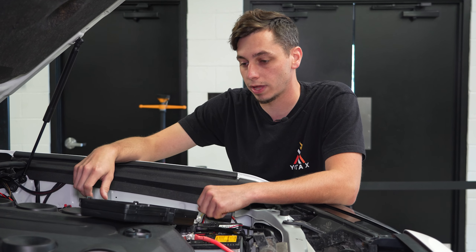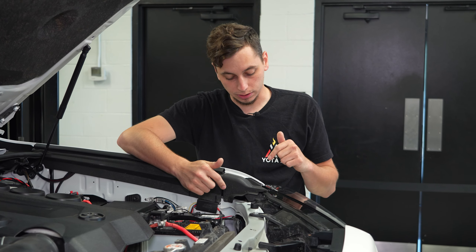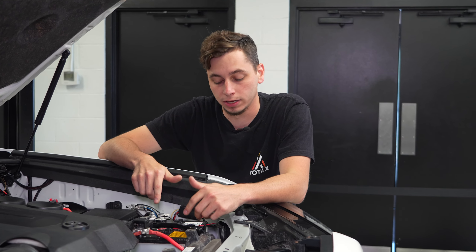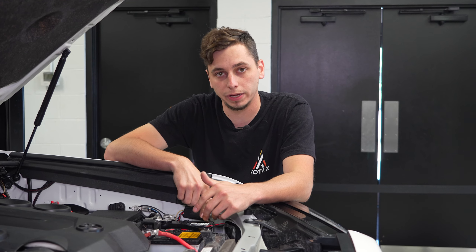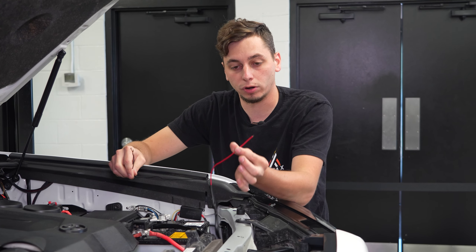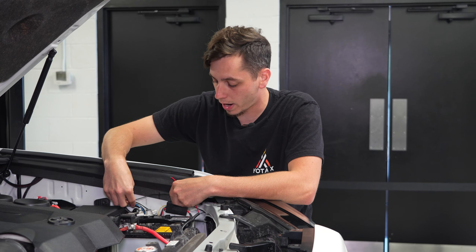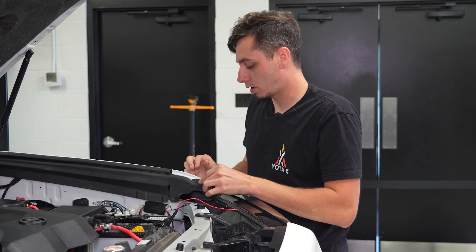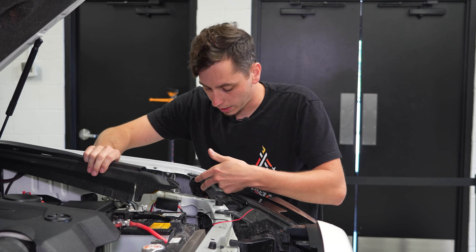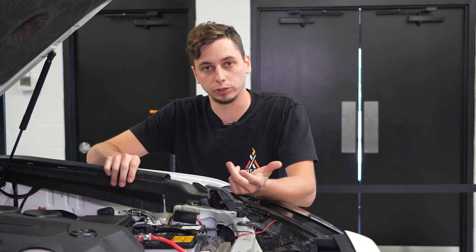For the wire tap method, underneath this plastic is the plug for the marker light on the very outside edge of your headlight — that's where we're getting power from. It's a brown plug with two wires: the green wire is the one we're looking for. We'll put our red wire to that green wire and our black wire to the ground on the inner fender. Pop this plastic piece off by pushing it towards your windshield, then look down inside to find that plug and unplug it so it's easier to work with.